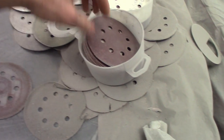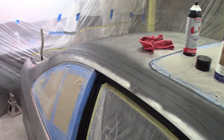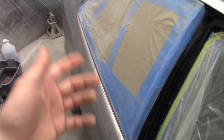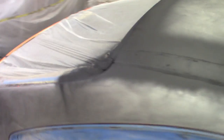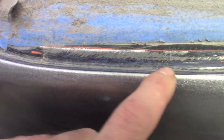Lots of little rust and dents along the top of the windshield. I did pull the glass on this just to make it easier. You can see some of the sandpaper we went through here — using 40 grit and 60 grit to chop away at the layers and layers of paint. This thing has actually been painted probably three or four times. I saw the black, the orange, another layer of bondo, and then another layer of black before I actually got down to the Si blue. Along here you can still see the original blue — going to go through this with a wire wheel.